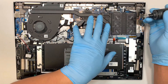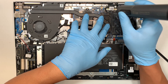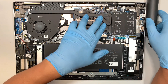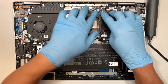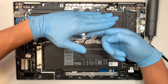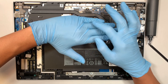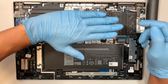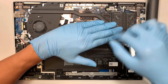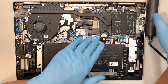The way I put the screws back is to not tighten any screw fully in one position — I go halfway through each screw and come back again. The reason is that if you tighten from the top first, the heat sink gets pushed down and tightened on one side, causing the thermal paste to be uneven. More paste would run to the bottom and the top gets squeezed out. By pressing it down evenly and going around all the screws in multiple rounds, you push the heat sink down flat all together.